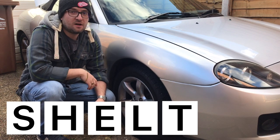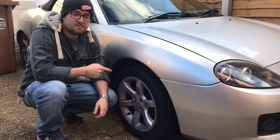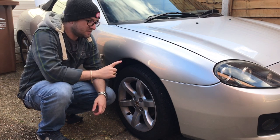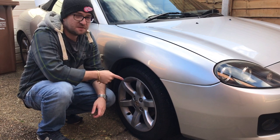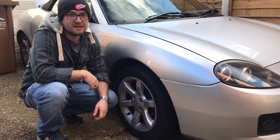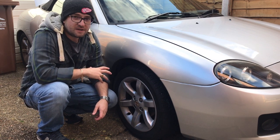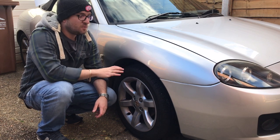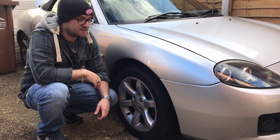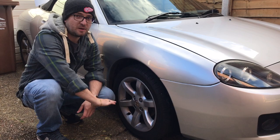Next up is T for tyres. When you're storing your car, make sure the tyre pressures are just right — for mine that's 1.8 bar at the front and 1.9 bar at the back. There are different tyre pressures depending on which size rims you've got; these are 15-inch so there's a different one for the 16-inch, and I'll pop the different tyre pressures in the description below. If you're storing your car for even longer periods, you could consider taking the tyres off altogether and putting the car on jack stands, which will stop the tyres from developing flat spots.